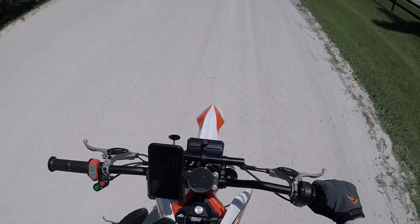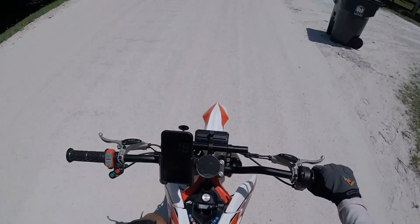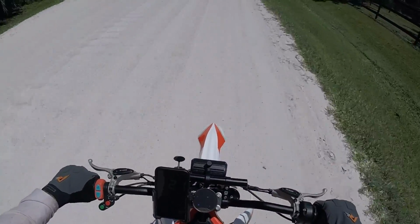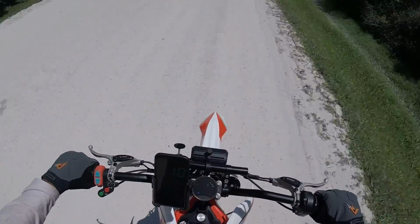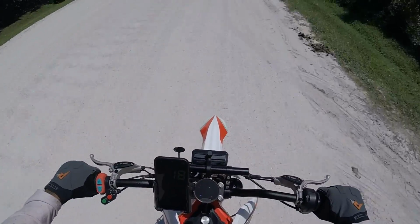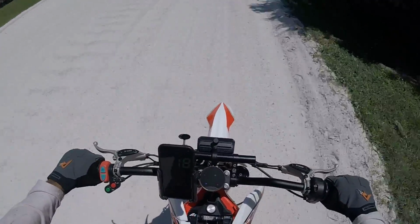But I think that with this reflash, we're probably gonna be able to maximize the speed regardless, just because we're probably not gonna top out RPM-wise now, because there's no limit. So let's see, the dyno was showing around 58 miles per hour before power started dropping off. So as long as we're under 58 miles per hour, we're geared fine.